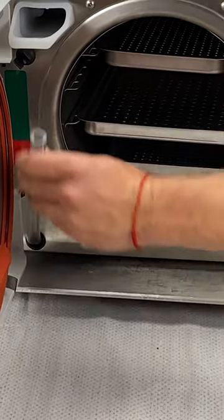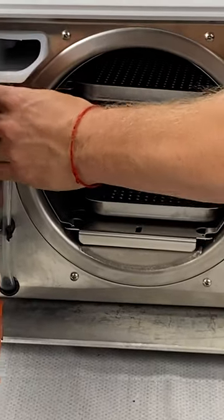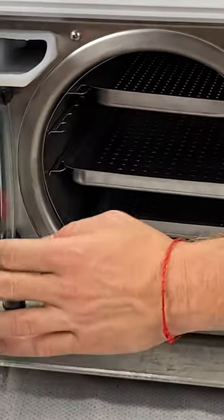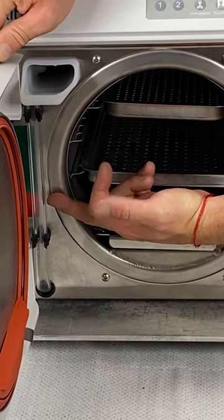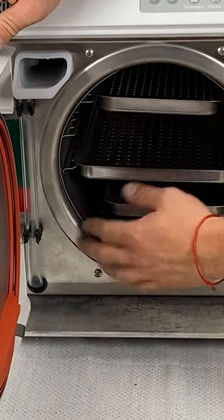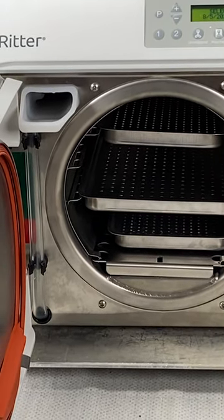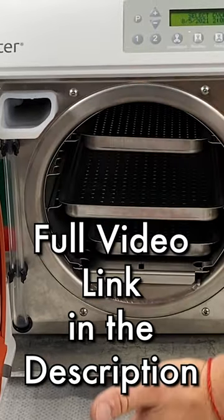The more often you do that, the better off everything and everyone will be. Because if you just keep adding water on top of old water — every day you come in and your water's down here in the red because you're running a lot of cycles, then you just add water, and you do this month over month, year over year — it builds up a biofilm so deep, an inch deep inside the bottom of your reservoir, that it'll take an army to clean it. So big pet peeve is draining your water weekly.